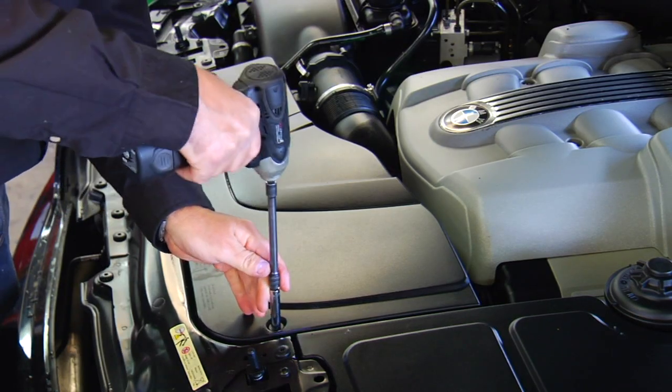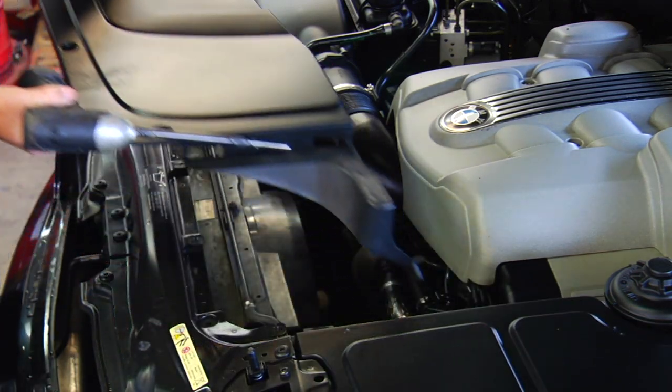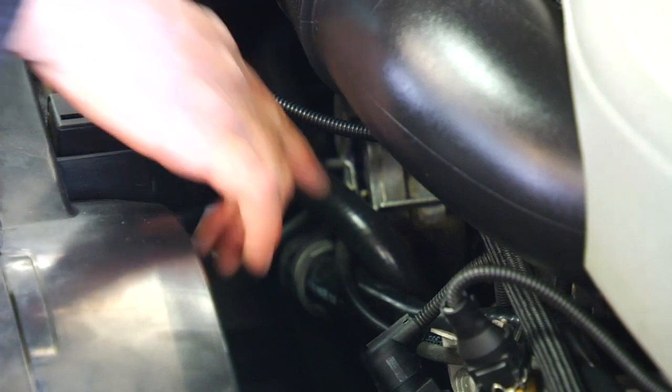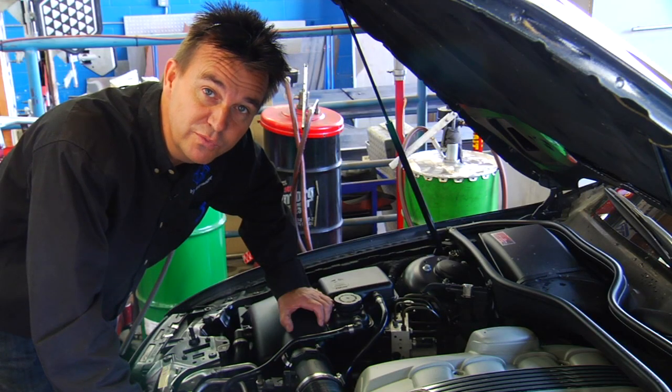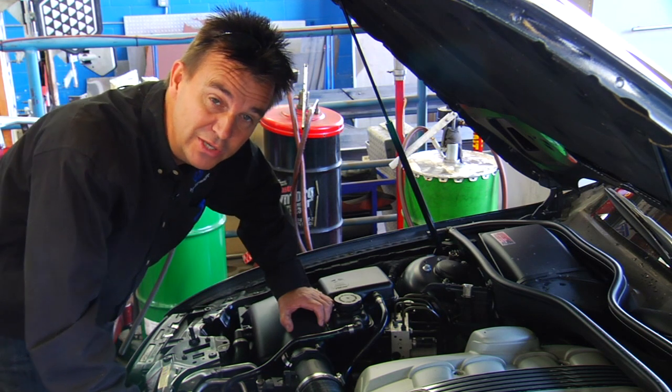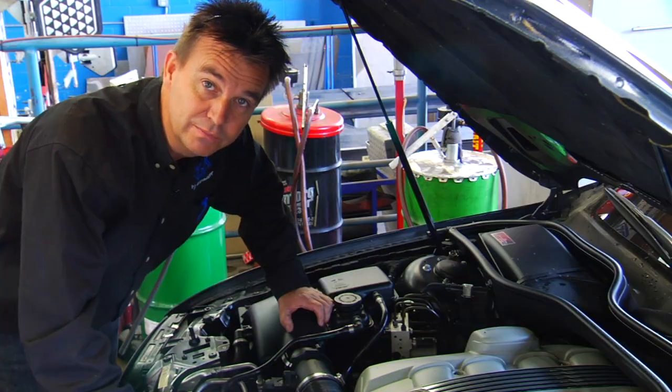This code is caused when the airflow from the secondary air injection pump does not reach the exhaust system because the system is blocked. Therefore the O2 sensors before the converter don't register a dip in mixture, and that's ultimately what sets the code and results in the check engine light coming on.